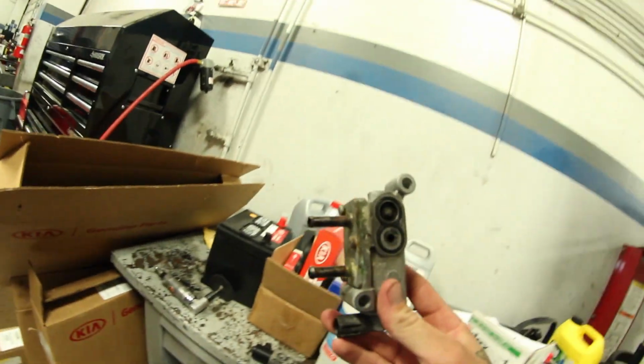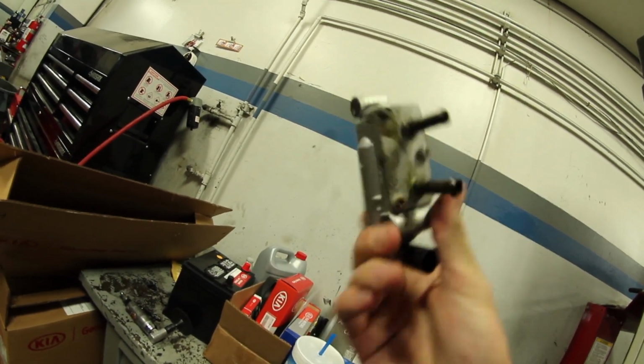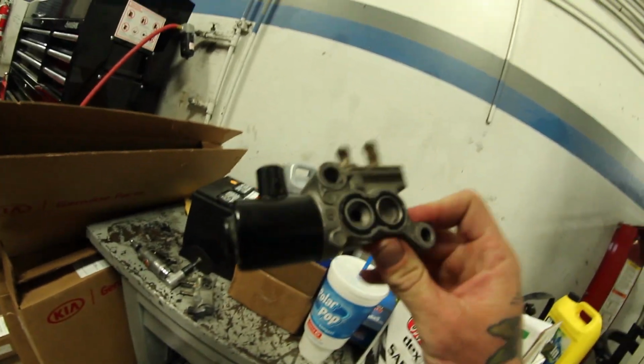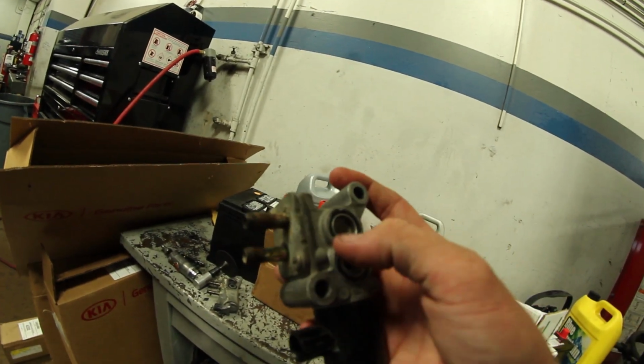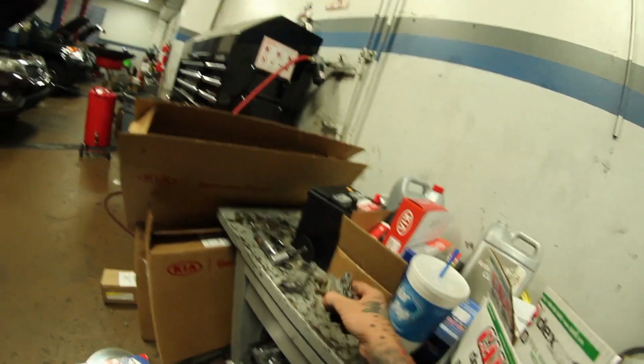Right, so if you guys remember when I put the motor together, I don't think I swapped out idle air control valves because this one definitely looks really crusty and it's painted, which I didn't paint my other one. And so here's the new one. Like I said, just got the 2 bolts right here. Make sure you got the gasket on there and 2 hoses in the plug. So plug this in and hope for the best, honestly.